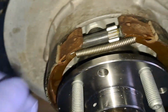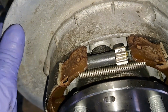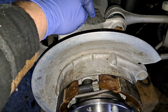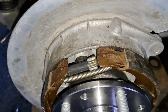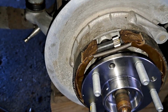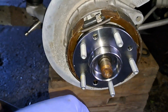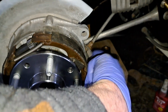and we can orientate the ears where our bolts belong. And then I've just run one bolt in through the top from the back side to locate it, and it's not tightened. I just threaded the bolt in part way. I don't want to tighten that one bolt and then risk not being able to thread the other two bolts in where they belong, down here and up here.